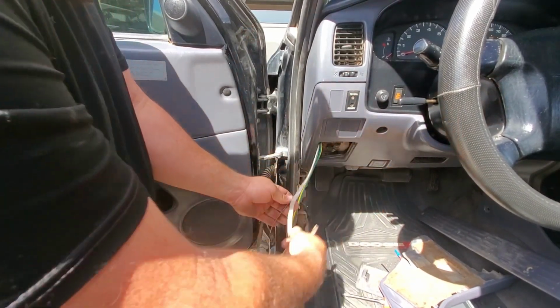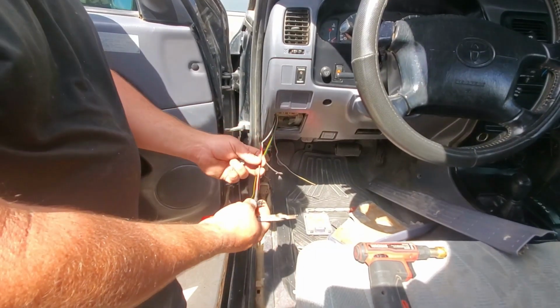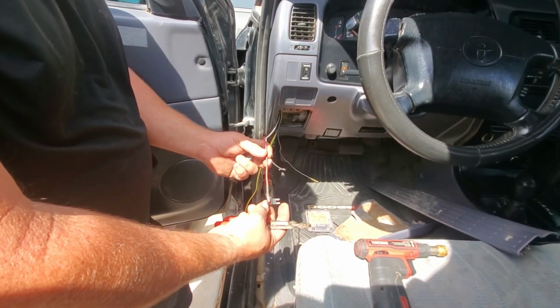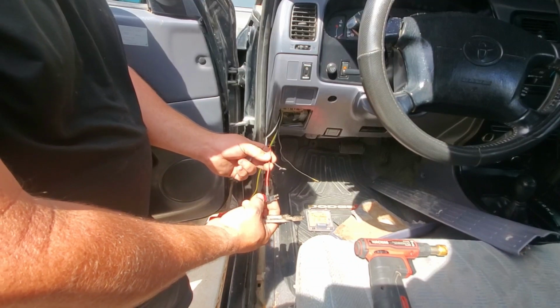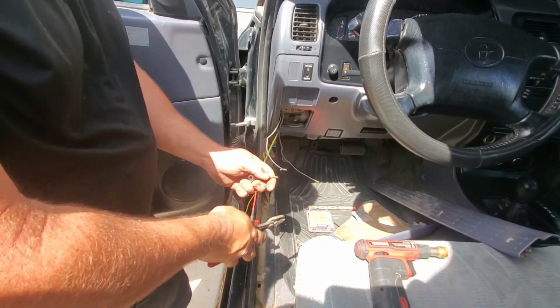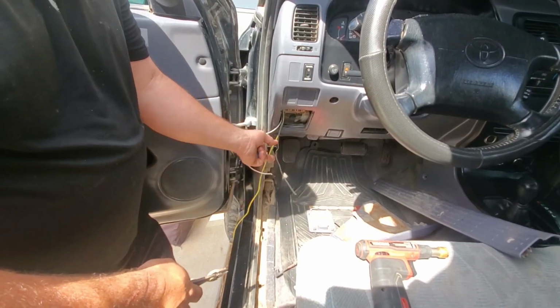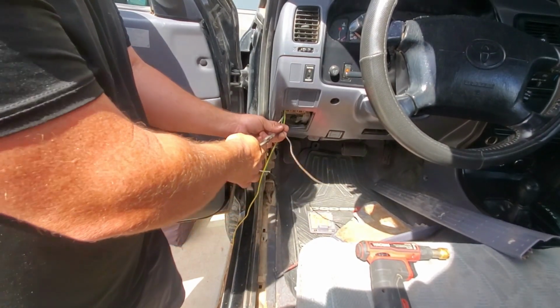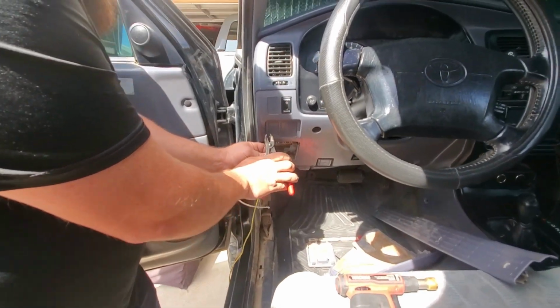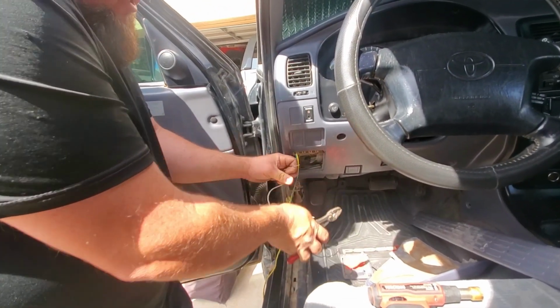to about there. Okay, for powering it, we're just going to use a fuse tap. You can pick these up on Amazon, fairly cheap. I'll try to put a link in the description. And we'll just strip this back. We're going to shorten up the brown power wire a little bit, just so it's not a cluster in there. And we'll just use a shrink butt connector.